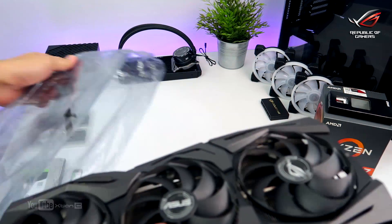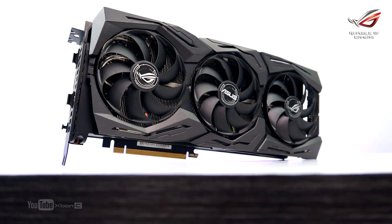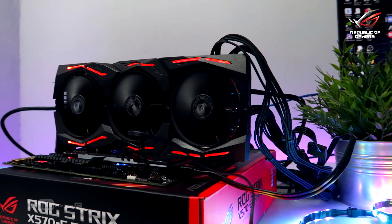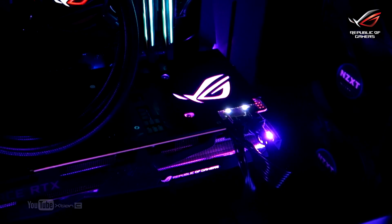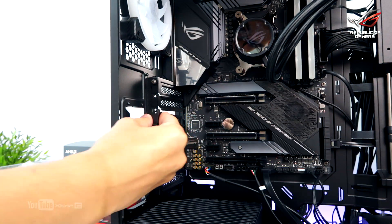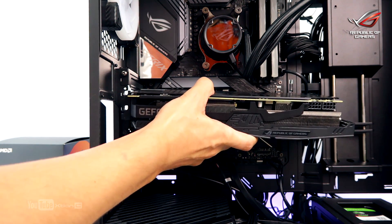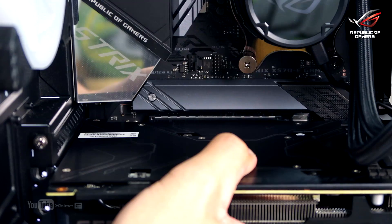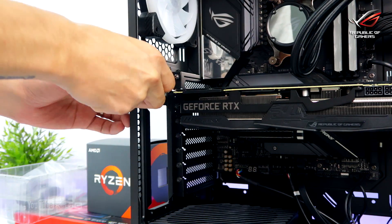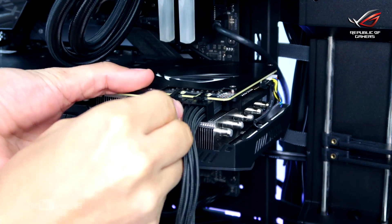Next step, we're going to install the GPU. We're going to use the top-of-the-line ROG Strix RTX 2080, which will give us all the GPU power we need to run our games. It has three areas of RGB illumination on the front, the ASUS ROG logo on the back plate, and a small ROG logo on the side. Installing the GPU is also a straightforward process. Remove the two screws from the PCIe brackets on the case and slide in your GPU. Make sure you align the notch to the PCIe x16 slot on the motherboard, use the same screws to secure the GPU, then plug in the 6+2 pin times 2 connector from the power supply.